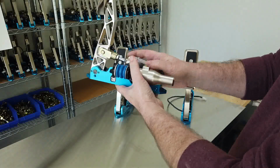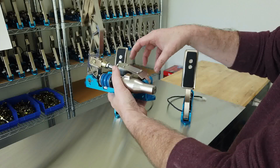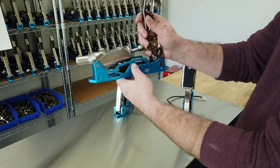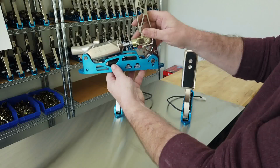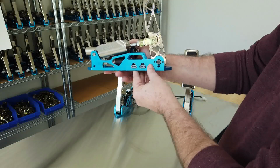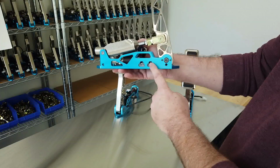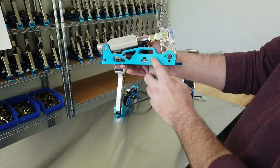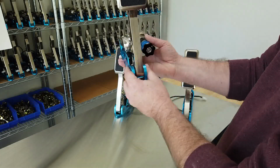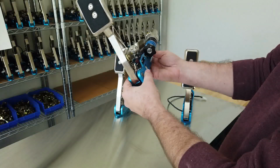So before on the PRX you had the master cylinder, of course, and the slave cylinder. You had a board box out here with the circuit board. That's all gone now. The circuit board is now tucked down in here within the base, and we now have plugs, whereas your clutch and your throttle simply plug in. Doesn't matter which one, they're not labeled because you can plug in either or, it doesn't matter. But with the circuit board in there like that, it makes for a very compact and sleek design.